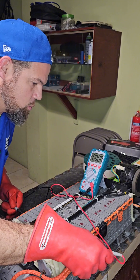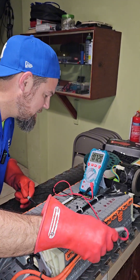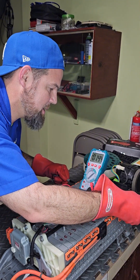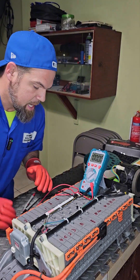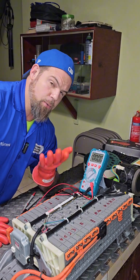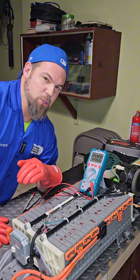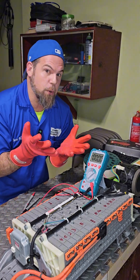Some modules are showing a little over 7.20V, which is telling us clearly that this battery is definitely out of balance. That is exactly what we're trying to do — deep discharging and deep cycling this high voltage battery to restore its maximum capacity. Unfortunately, with a battery that has already suffered heat stress, you won't fix the problem, but this process will prove it. If you want to learn more, stick around — and don't forget to subscribe.